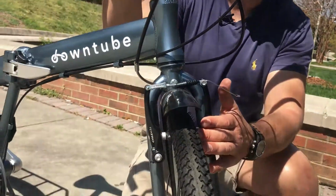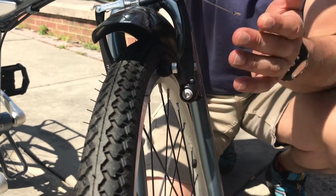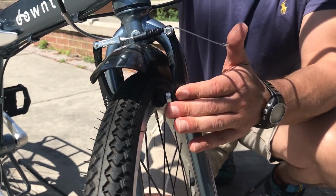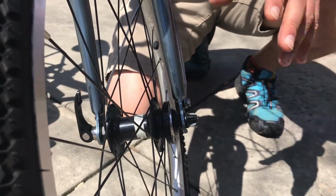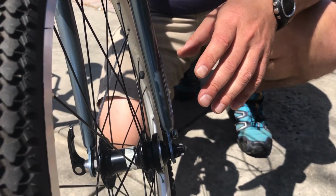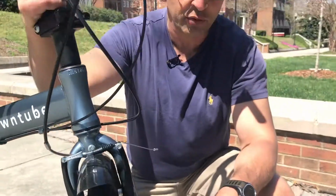And when I say the mountains, I mean extremely steep mountains, because if you live in the mountains, when you descend, these regular V-brakes will actually melt by the time you're at the bottom of a mountain. Either you use them and they'll melt, or you don't use them, so you'll have them when you need them, and your life's at risk. So disc brakes are essential in the mountains when you're descending, phenomenal mountains. For the majority of the population, that is not necessary, and the risk of bending the rotors outweighs the benefit for most of us.